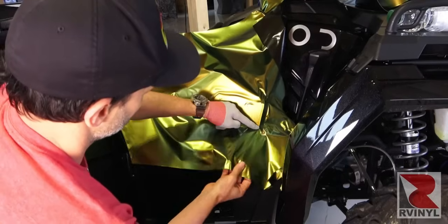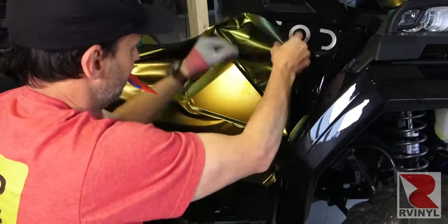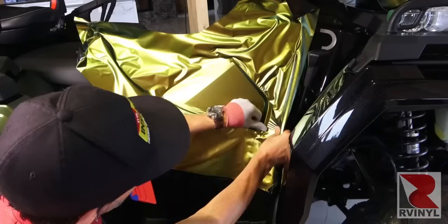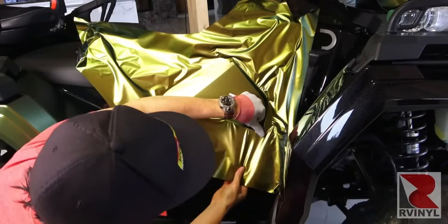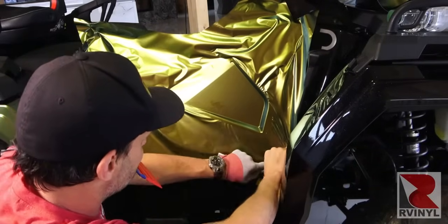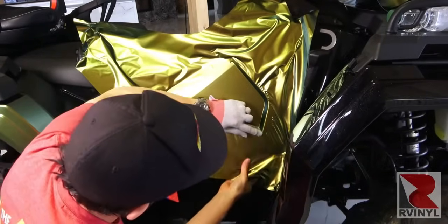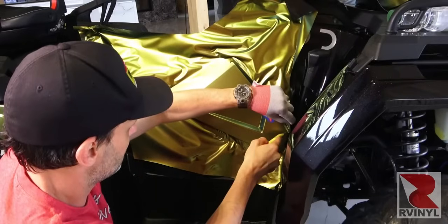So the material started at the deepest part of the recessed area and then fed out. This requires the use of an application glove, a heat gun sometimes, and a squeegee, but this really neutralizes the stretch in the deepest part of the recessed area, and then using a combination of the right techniques, in this case the triangle technique, to spread the material out to the outside corner, the material can now be fed to the rest of this area.